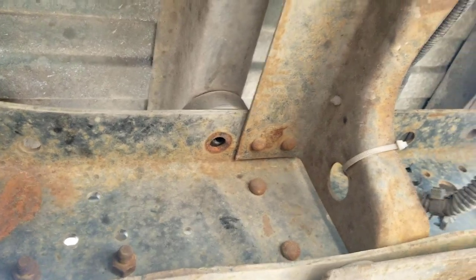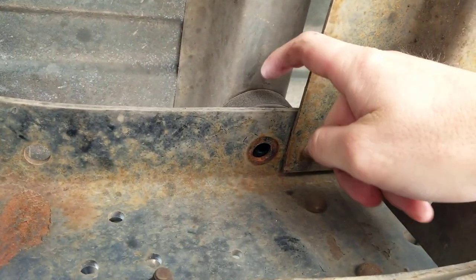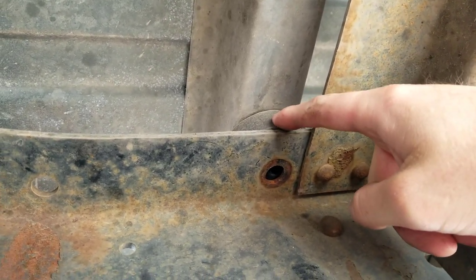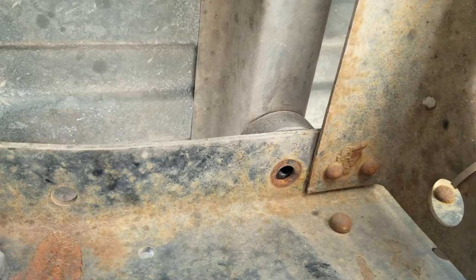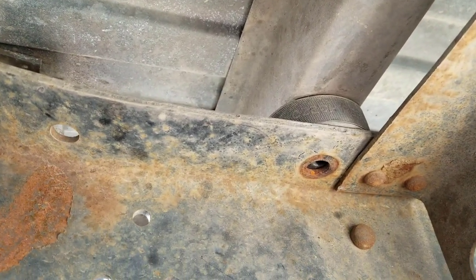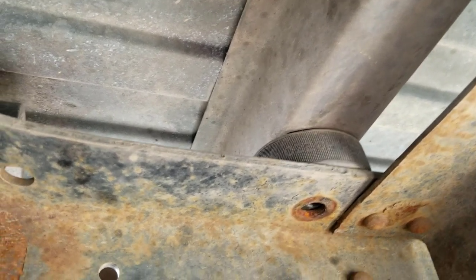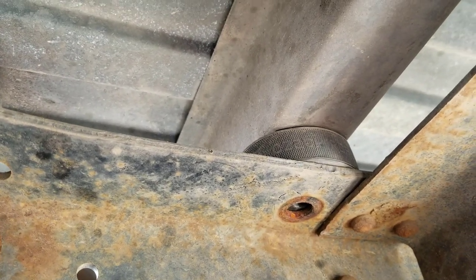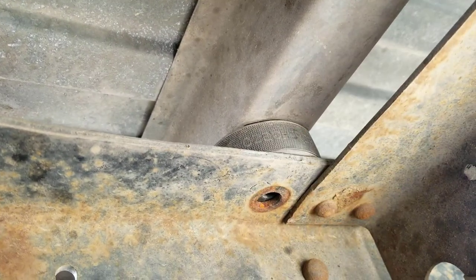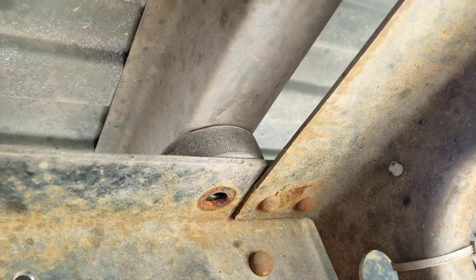One thing that I kind of laughed about as I pulled these out: to do the crew cab, most of the time you have to run a 1-inch body spacer. And I could not for the life of me get a company to ship some poly bushings up to Alaska for, you know, under $100 shipping. It was crazy. So I just went out and bought hockey pucks, threw them in there. So this will be nice because we'll be able to replace those with the poly bushings.